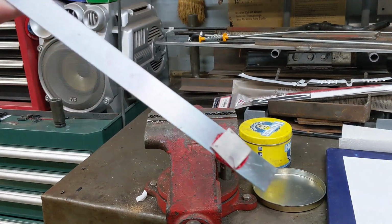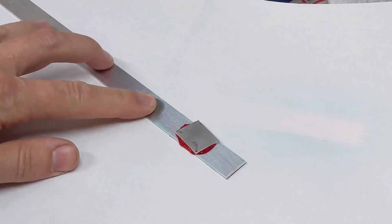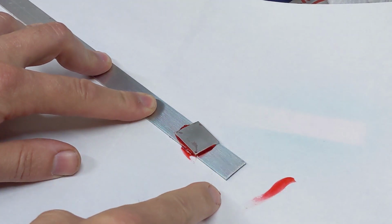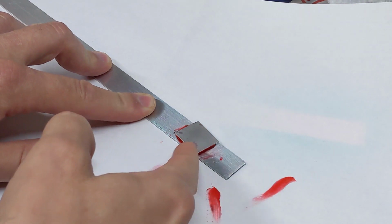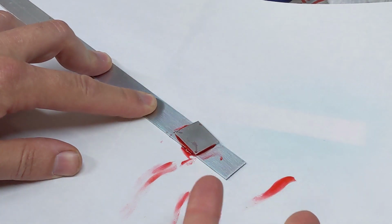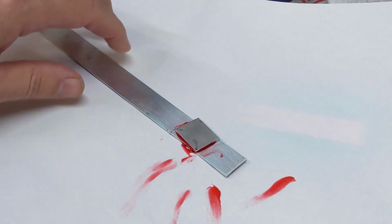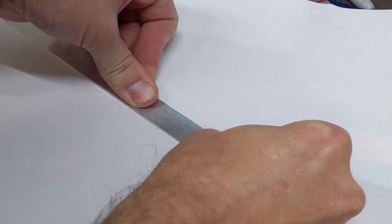We're going to go ahead and pull this out of the vise, basically unbolting it, if you will. And I'm going to set it down and take a look at this. If you're not familiar with anaerobic sealant, the fact that I can just simply wipe the sealant with my hands and it is the same as it was a day ago is kind of disturbing. It makes you wonder why it didn't harden. But once you wipe all this off,